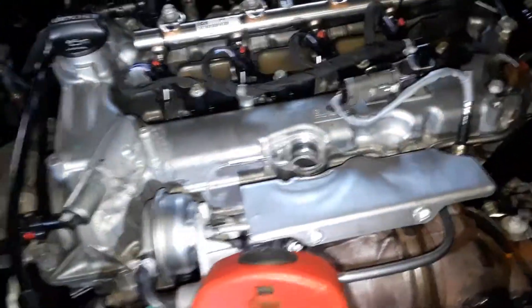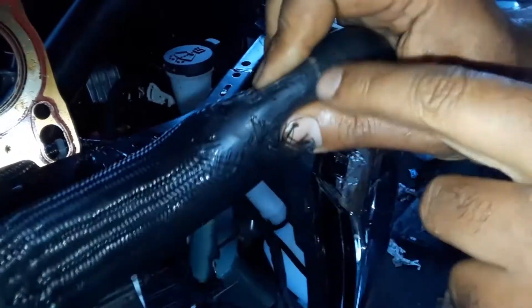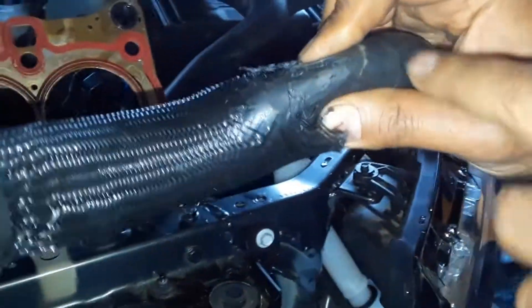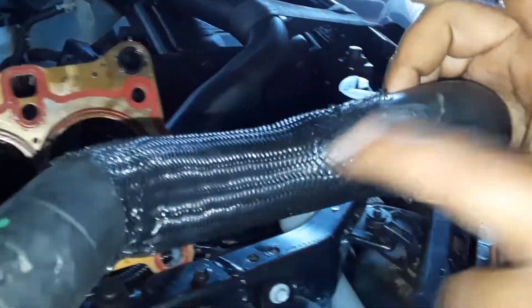Usually you have to take the head off. You'll see the hose goes bad underneath the air conditioner — there's a hole here, that's what does the whole job. The hose hits the air conditioner compressor and belt right here. You can see it's rubbed. So then it gets a leak, then it overheats on a brand new car and the head gasket has to be replaced.